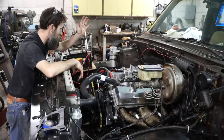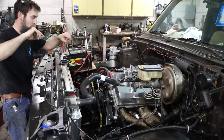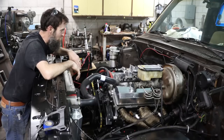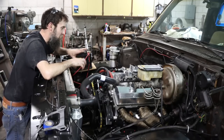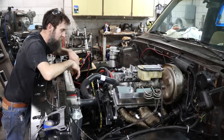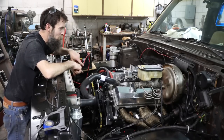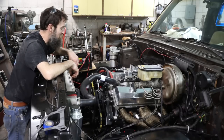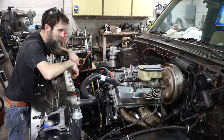We're not getting much blow-by at all through the vent, though. I think we're good. I see a little bit of smoke coming out of the vents, but that's normal. Nothing excessive. And that should slow down as these rings bed into the cylinder walls. Just charging good. And what else? I'm just super, super excited. This thing is awesome. And I think that it's going to make a great, great engine.